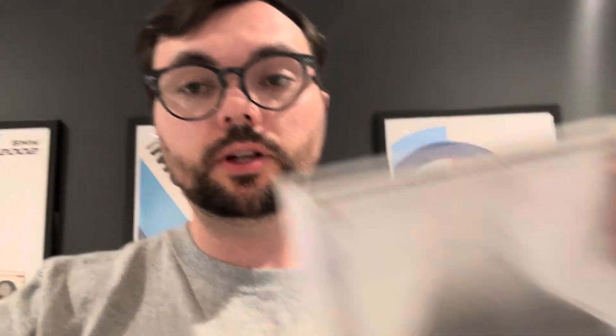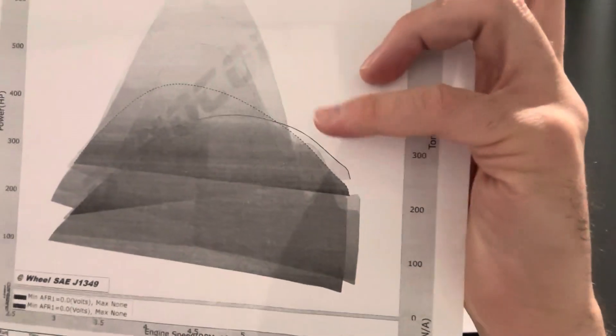So I tried leaning that out and it did help clean it up. It picked up — looks like about 30 wheel torque and maybe 50 horsepower average on that graph. I was having issues with injector control but I was able to lean it out a little bit up top and clean it up. Then on the last pull I think it was like 22, 23 pounds of boost.